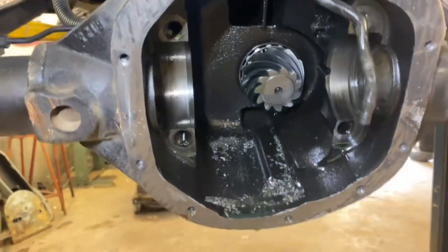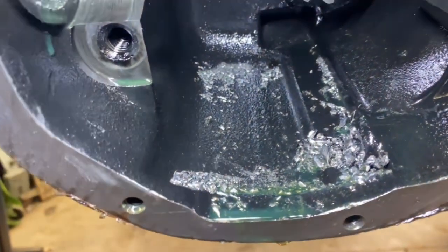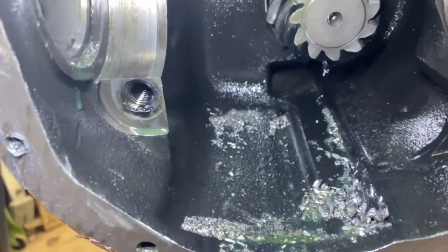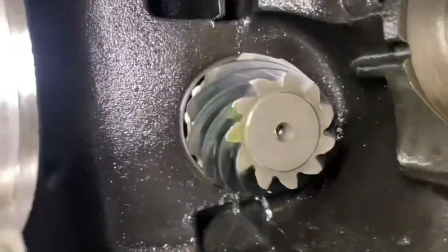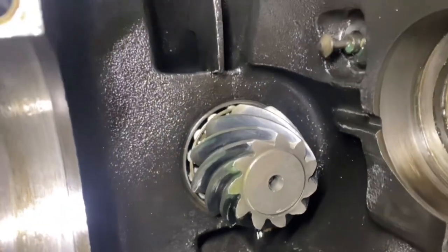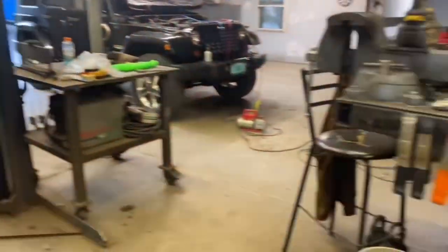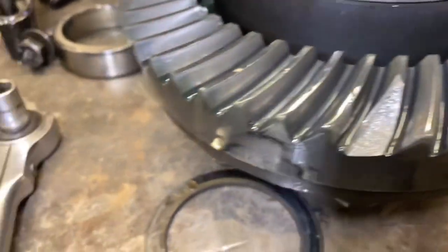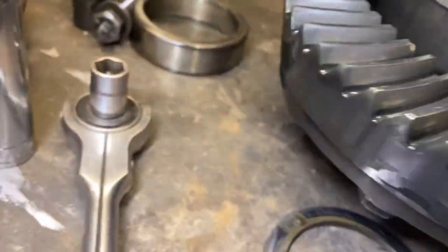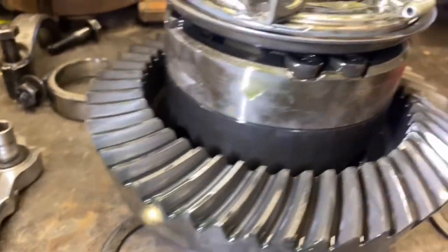Carrier's out, and there is quite the pile of scrap metal in the bottom of this diff. Notice the pinion gear — all the teeth are intact. I just turned it; they're all there. However, one tooth is missing from the ring gear. That alone would not account for the issue — that tooth is probably what's ground up in the bottom of the diff. I'm going to get the rest of this apart, try to split this carrier, and see what's going on inside it.